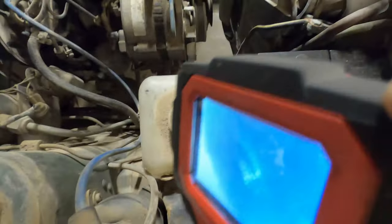Okay, so I don't know how well this shows up, but I'm in cylinder one and you can see crosshatching actually on the walls. So that's great. It's a great sign that there's crosshatching. Four. So I'm guessing four and one are companion cylinders. The top of the piston head on cylinder 4 is kind of carboned up, but looks like there's cross-hatching.